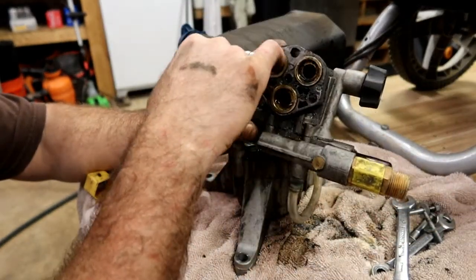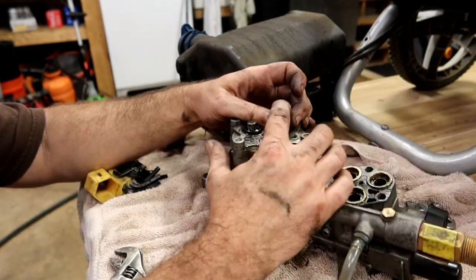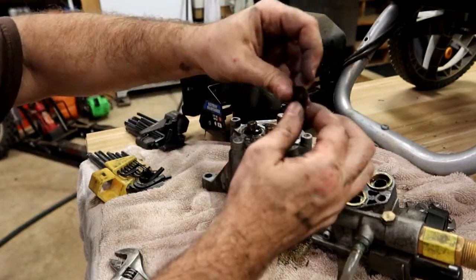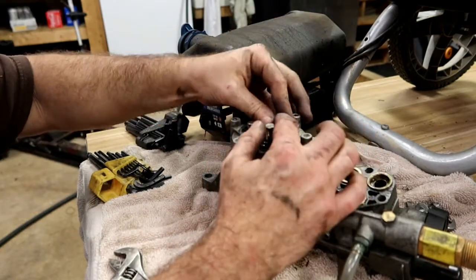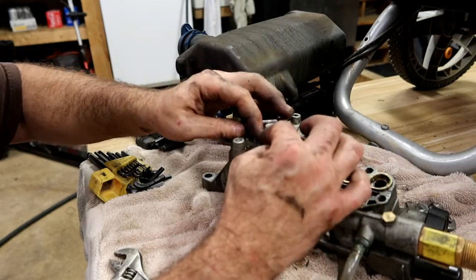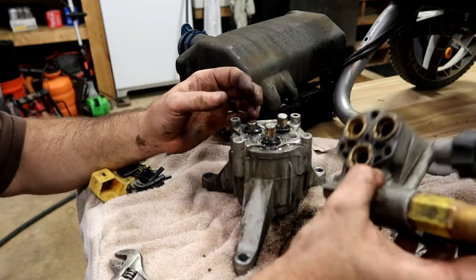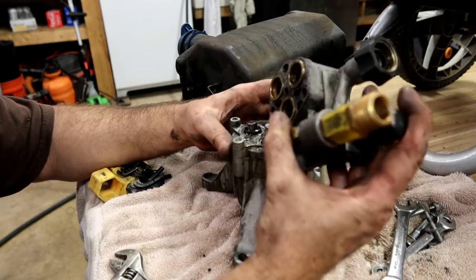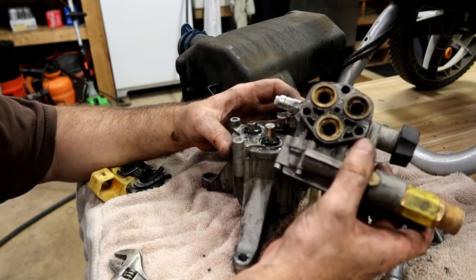So anyway, there's rubber cups in here that seal up along here, and then of course there's also these gaskets right here. So, when you run these dry, they have no lubrication. The metal rubbing on this rubber will wear it right on out, so that shouldn't go on that easy. I've also got loose stuff in here, loose chunks of metal, which means loose chunks of metal that is on the inside of the pump, for me, means I'm done.